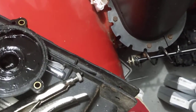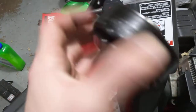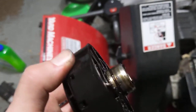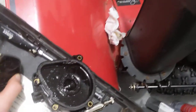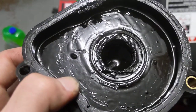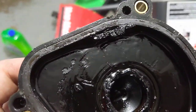I just wanted to show off the state of my drip pan. What happens is this end slides into the engine essentially, and this is the guy. You can see he's got these kind of fans that dissipate the oil as it's flowing through the top end while the engine's spinning. You can see there's some erosion on here, and what that would mean is as the car is driving, as it wears over time, this is going to start to wobble a little bit. On the housing itself, there's a pretty tight gasket seal that slides directly over the mouth of this, sealing it off from leaking any extra oil into the hoses that vent back to the throttle body. In my case — and clearly the reason I was having such an issue — this is no longer a gasket. The diameter is normally probably a half inch, just guessing, and this is a pretty substantial hole now because you can see it's all eroded away. There's some gunk in the corner, probably from it trying to vent.